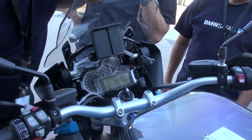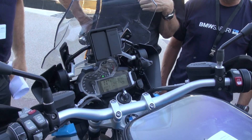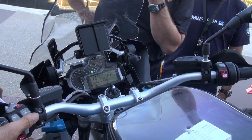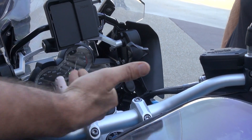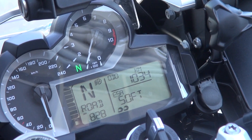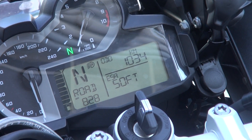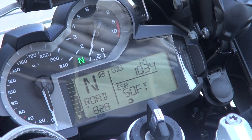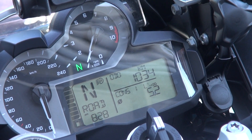You're at a single helmet preload setting in the normal damping. You need the engine running to make an effect to the preload. Press it once to wake it up, press it again and it moves to the next setting — helmet and luggage, so we've got panniers or a gear bag on the back. Press it again and you get two helmets, meaning you've got a pillion on the back. That's affecting a preload change to the rear only. We're one rider today without luggage, so we'll start in the single helmet setting. While it's flashing, the change is taking effect.